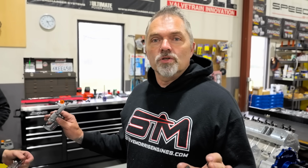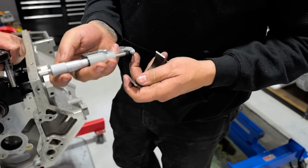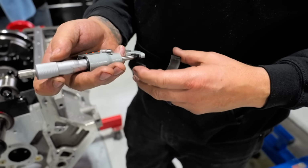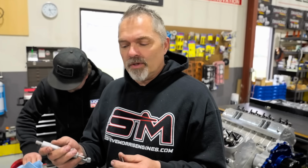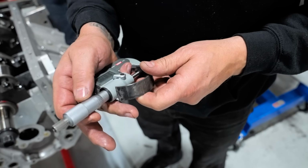And it's like, wait a minute. The only reason we put bearings in it was just for the sake of putting new bearings in it, which I generally don't do. I've told you this before, if this thing has perfect bearings in it, don't just put them right back in. They're happy. Everything's happy. So we literally dug the old number 1 bearing out of the trash and said, here, put that back in there and let's see what it does. And by golly, untorqued it turns and torqued it turns. So there has to be a problem with the bearing. So I grabbed my bearing mic, and this is why everybody wants to think, just throw bearings in it, they're cheap. No, if something is perfect, don't replace it. And I'm hoping there's gotta be something going on here, because that just ain't right. Now here we are.